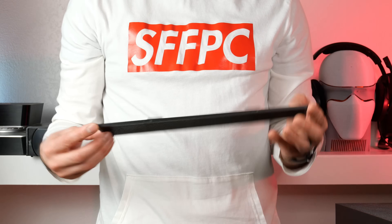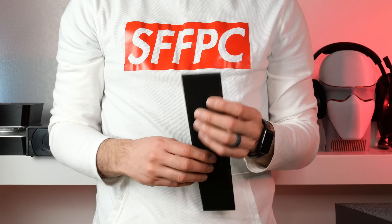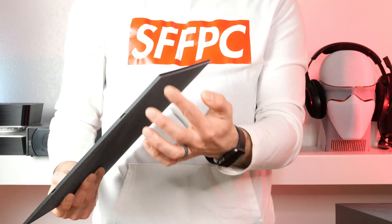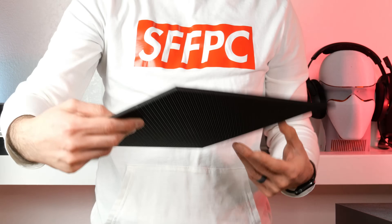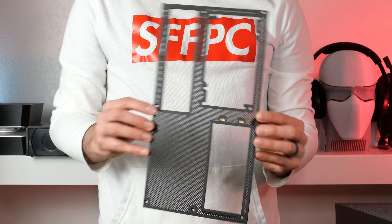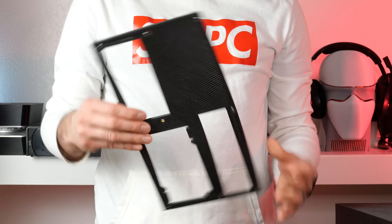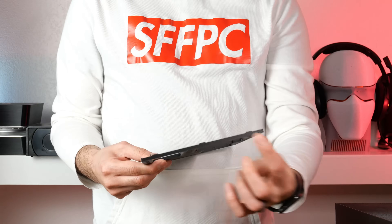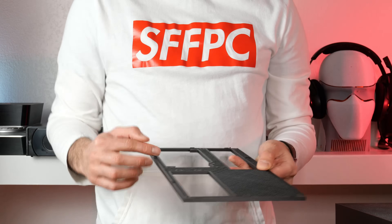This part fills in another gap while providing some venting — it'll be fixed with two screws and keep its alignment with protrusions and indents along its edges. This is the main side panel that allows ample venting and stays in place with its slide rail interface, also with protrusions and indents along the other edges. The rear panel is also a mesh — the three gaping holes correspond to the motherboard, power supply, and GPU. It has screw holes that attach to the motherboard tray, top panel, and bottom panels, with indents and protrusions throughout to align the other panels.